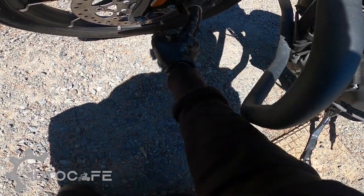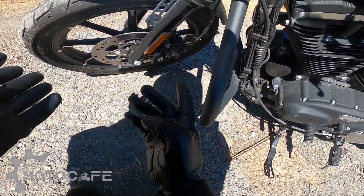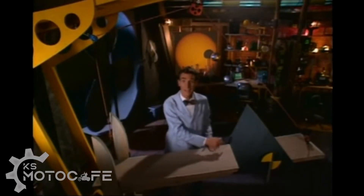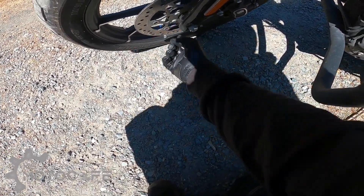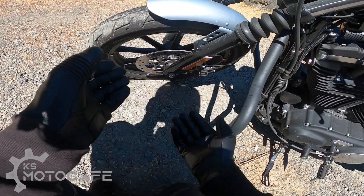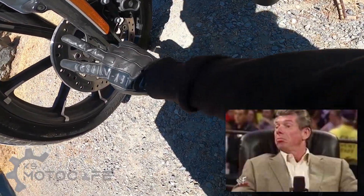At the brake, the fluid splits into your pistons, pushing rods onto a brake pad that grips your disc. The more pistons you have, the more pressure you're putting onto the disc, and that pressure is also being split into different surface areas. That's important because friction creates heat. If you have only a single point of pressure on the disc, it's just going to heat up that one location — which gives you brake fade — and brake fade lowers the efficiency of your stopping power.